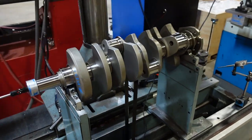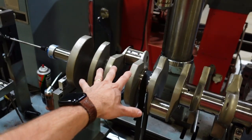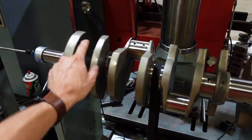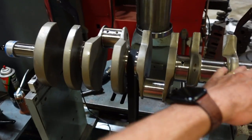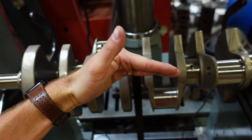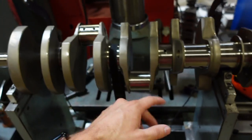Right here we have our crankshaft. This is one of our Smedding 4340 forged steel crankshafts. Because this engine is going to make so much power with so much displacement, we have these crankshafts made with center counterweights. You see that on a lot of very high-end high RPM race engines, but we are going to start introducing that technology into our street motors starting with the 1,000 horse 632s. Center counterweighted crankshafts evenly distribute the balance across the entire crank so that at really high RPM the crankshaft doesn't start to bend and bow in the very center. Center counterweights take care of that.